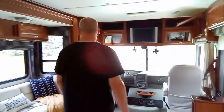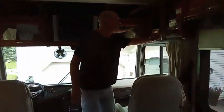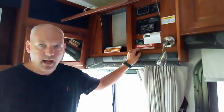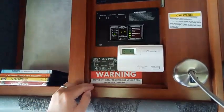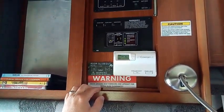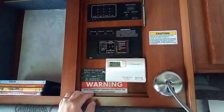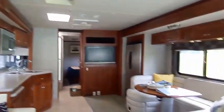Let's get to moving the slides. I'm going to start with the big one and operate it from the system up here. Noticing my warning sign again, but we did move the driver's seat, so we're in good shape. Here is the room slide-out — this is the big one. I'm going to have Noel stand near the stairs to watch it, because the slide operates interestingly: it actually lifts up toward the ceiling and comes in on an angle. That can look a little strange, but it's normal operation. The RV does need to be running for the slides to operate, so we're going to start it up.